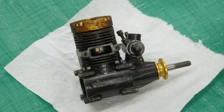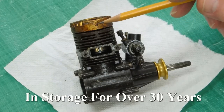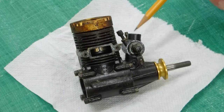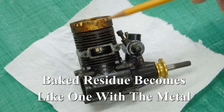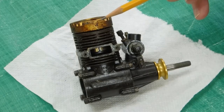I'll show you a little bit about how to clean model airplane engines and a few other things with ethylene glycol or antifreeze. This is an HP-40 engine. Some careless owner never cleaned it. With the castor oil based fuel, you'll get some blow-by out of the carburetor and exhaust that will get onto these fins and on the head and will bake on there, and you'll end up with this brown, black crud that you just cannot get inside all of these fins and clean out.